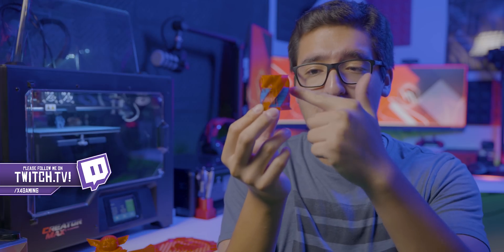Now of course this 3D printer is not perfect. There's one thing that occurred that I'm really upset about — the filament got stuck inside, and it happened multiple times. I needed to take it apart a bit and remove the stuck piece, and that messed up an overnight 3D print. This was supposed to be both red and blue, but it stopped midway because it got stuck, ruining a 9-hour overnight print. On top of that, the left extruder got a filament clog that I have no way of removing, so now that extruder is useless and I'm just left with the right extruder. I wish there was an easy way to unclog it and prevent the filament from getting tangled inside. At $880, there should be an easy way to unclog the filament, and it shouldn't be happening constantly.